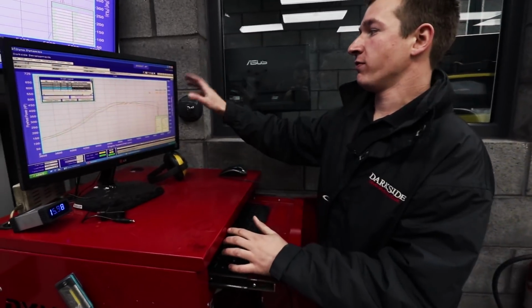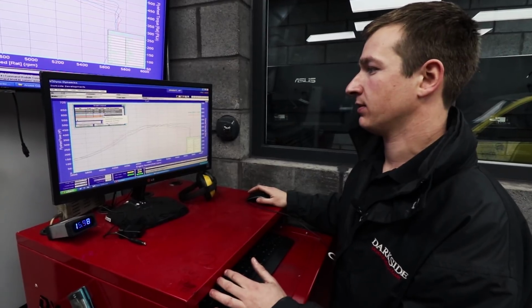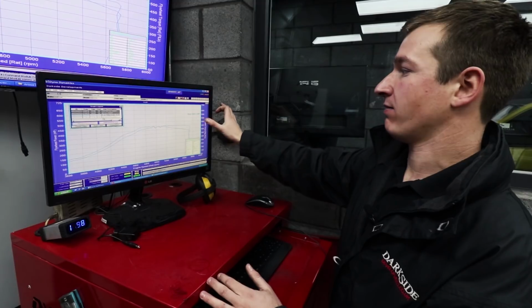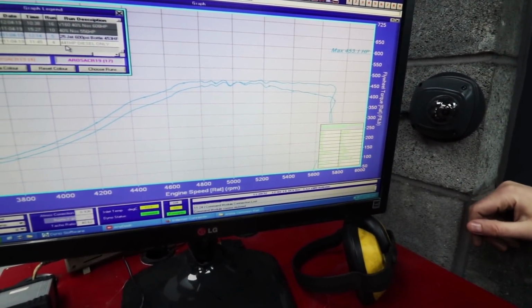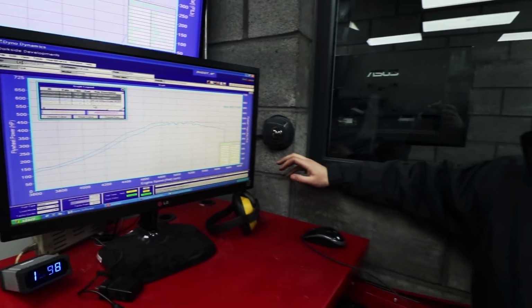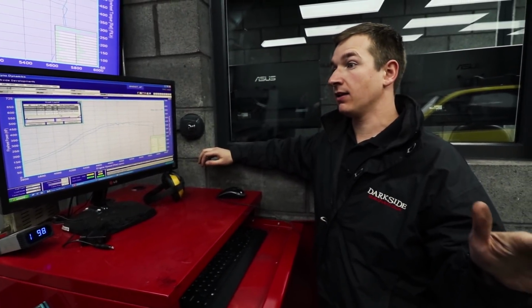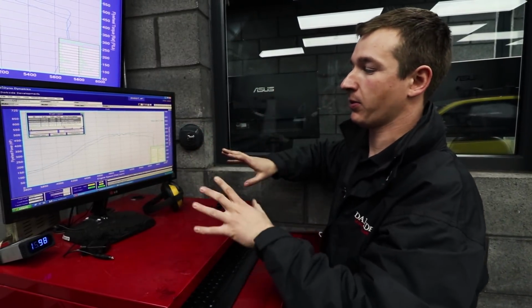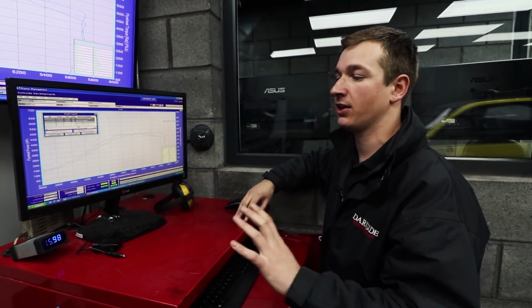So we've got 450 with that little nitrous jet in there. So I'll just hide this one because it makes it hard to see when you're seeing everything. So 450, that's the baseline figure. We're normally around 450s, 420s, depending on the day, the temperature, everything, last year. So we've changed the nitrous since last year as well. But then, this was the baseline. We're happy with that. The nitrous, we weren't getting any leaner than we were last year.